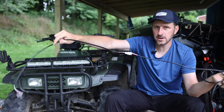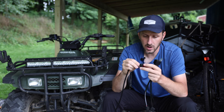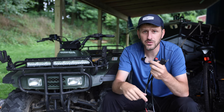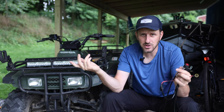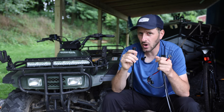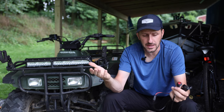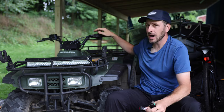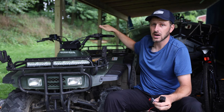Following the harness back, you get to a big cluster of wires coming out of this relay. There's also a long wire with a really nice little switch — it has a waterproof seal around it and it's lighted, so when your lights are on you'll have a lit-up red light inside the switch. Now, the really easy way to install this on my four-wheeler would be to connect the main red and black leads to the battery, find a place for the switch, and connect the other end to the lights. Most of these connections are already pre-set up with connectors — super simple. Except there's one big holdup: if I hook it up that way, the lights would be able to be powered even when the key is off. I really want the lights to go off with the key.